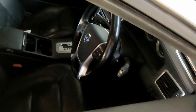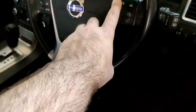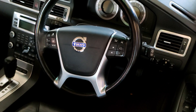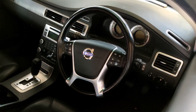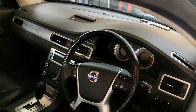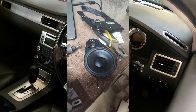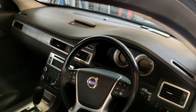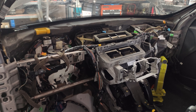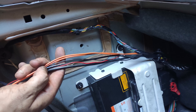Another comment on steering wheels — this is what's called a P3 Mark II steering wheel for an XC70. The V70 had a Mark I wheel which didn't have the aluminium trim panel. I used this wheel because I had the hopes of getting my RTI screen working again. The only option that the V70 didn't have was it didn't come with the RTI screen. Although it is terrible as far as the GPS goes — maybe in Australia, maybe in general — it's better than nothing, and when I travel outside of my comfort zone I like to have it open. So I reinstalled that and spliced all of the wiring accordingly for that screen back into the V70 loom, which runs all the way across the dash loom, runs down the driver side guard, all the way back through and into the boot, where you'll find a DVD module with a map disc for the GPS.